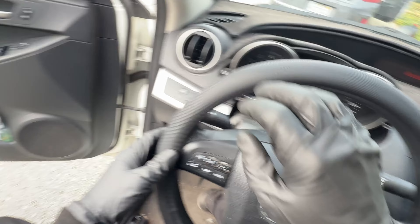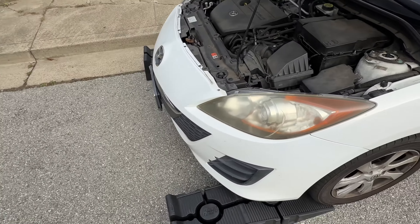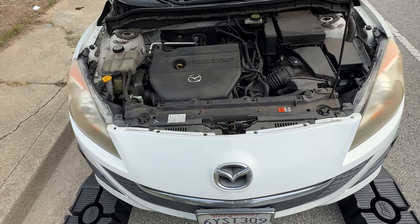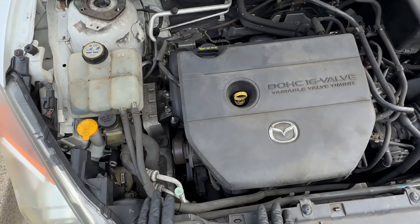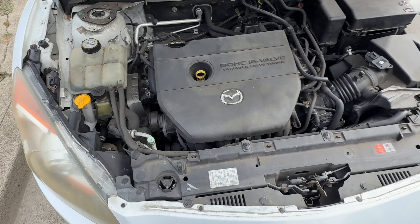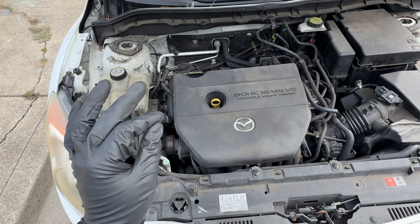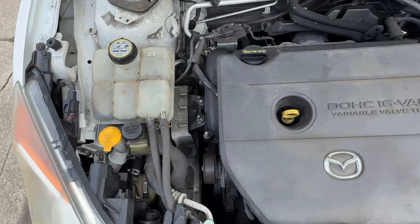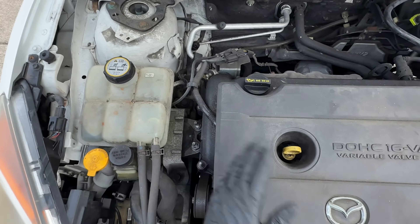Anyways, go ahead and put this back. I'm gonna start with the repair. You don't need the ramps if you're only doing the top mount, but if you're doing the torque mount under the motor I would highly recommend putting it on ramps. Then it's just supporting the motor - all you need to do right now is get a jack and put some support on the motor from the bottom. You can use a block of wood.